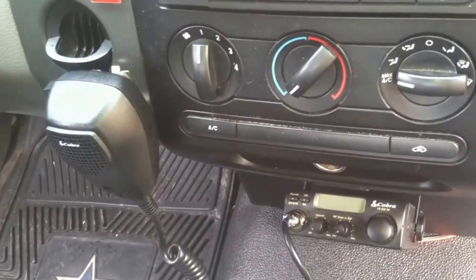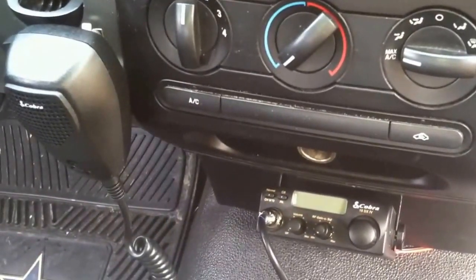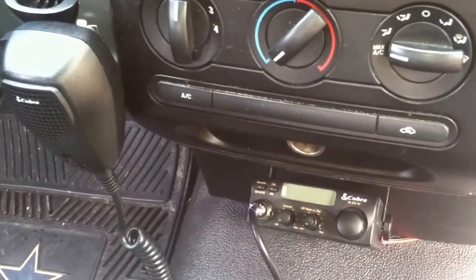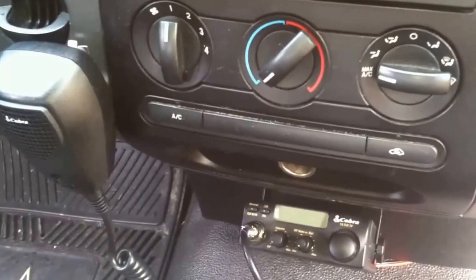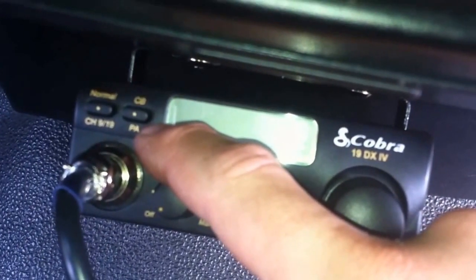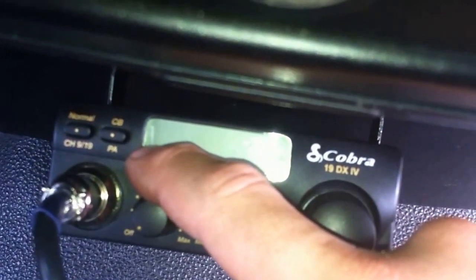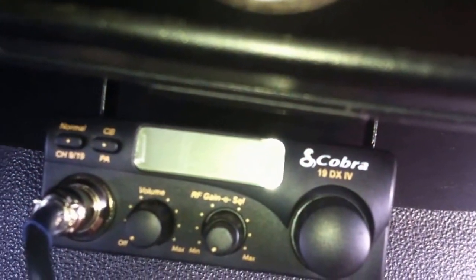I hope to iron out all the wrinkles in this video. I have a Ford F-150, a 2006 model, and the CB radio I chose is a basic starter CB radio — just an old compact Cobra model 19 DX4. It's a basic model; it has a quick switch that allows you to switch from channel 9 to 19, and it has a CB/PA switch. To use the PA on this I'm going to need an external speaker, which is very easy to install — there's just an audio plug in the back. I basically screwed the CB radio right below my cup holder.